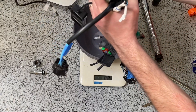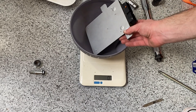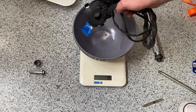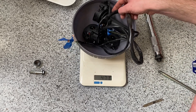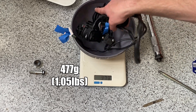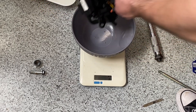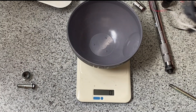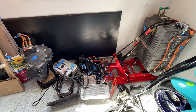Let's shove the whole harness in this bag as much as we can — 2.3 kilos. The VCU: 661 grams. The mode stuff, starter thing — and I'm going to use the throttle in the car — that's 470 grams. Definitely using the CCS charging port, let's say one kilo. The Energica Dash is 376 grams. And last but not least, Pablo the fan — about 400 grams. Everything you see in the frame is going into the car: battery, charger, controller, motor, and all the extra stuff.